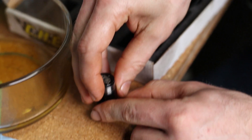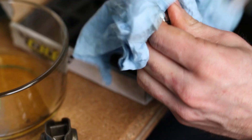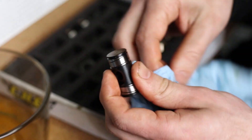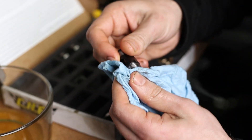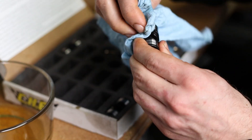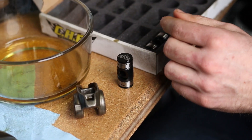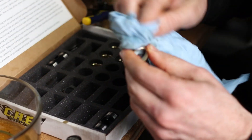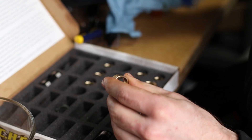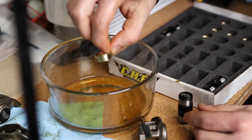Now we're going to take our new trunnion. I've already pre-cleaned all of these trunnions by soaking them in mineral spirits and then soaking them in motor oil. Just wiping them down now to make sure they haven't picked up any contaminants. We're going to set the trunnion down flat, then take our bearing — these were also cleaned and soaked — and dip it in fresh motor oil per their instructions.